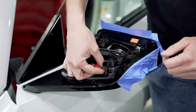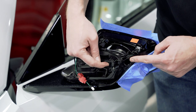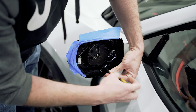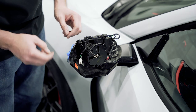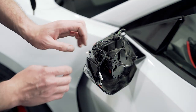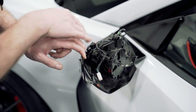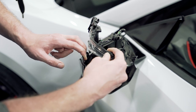Start by locating the connector and unplugging it — there's no clip on it, you just have to wiggle it and pop it out. Remove a Phillips head screw from here, here, and here. Access this one Phillips screw and take it out, then take the outer trim piece off. Now that the trim piece is off this light, pull this tape off the side — we won't need that anymore. Take the top piece of plastic that is part of the outer trim of the mirror and pull it straight out and back. You do have to pull it out pretty far, so make sure you're in a warm environment so the plastic isn't cold. The light you can just wiggle straight up and out.